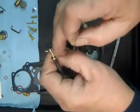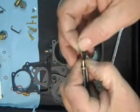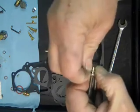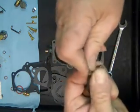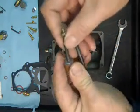There are three positions: a top, middle, and a lower one. You should make note of which position it's in when you take it apart. But if you forget, just use the middle one. And that's it for the accelerator pump.